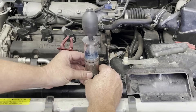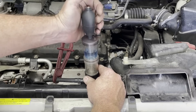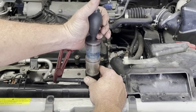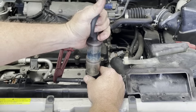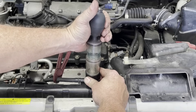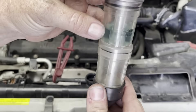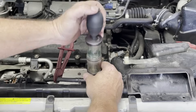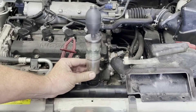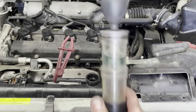It's still starting and running well — let's sit this on here. Usually after 30 seconds to a minute we'll start to see a colour change, but I'm just going to start drawing it up through. As we're starting to go, you can begin to see that colour is starting to turn more yellow — it's getting away from the blue. What was originally blue is now going a yellow-green. I've seen enough now to know that that colour's definitely changing. When using these, make sure you don't hold it up like this because it'll just suck in ambient air which contains CO2. Let's shut this engine down.